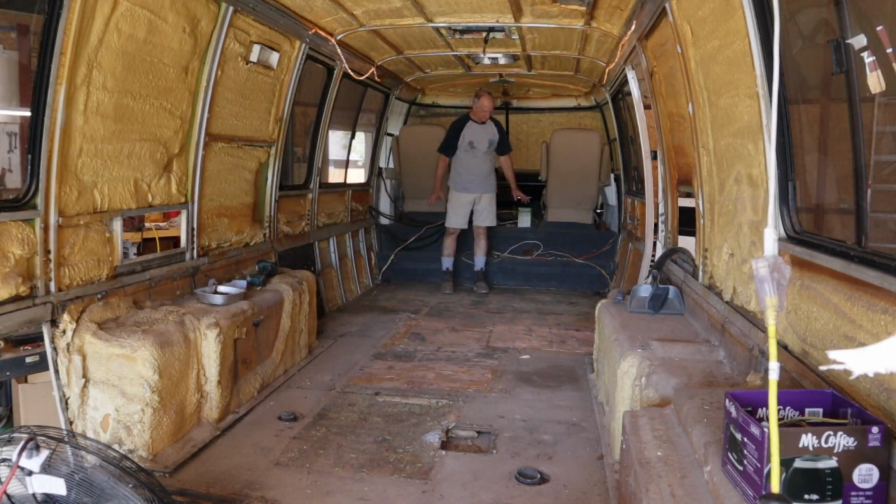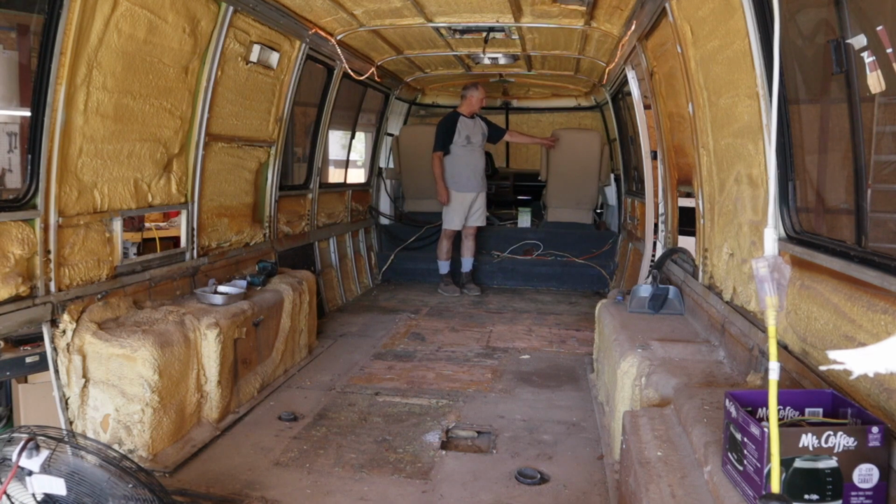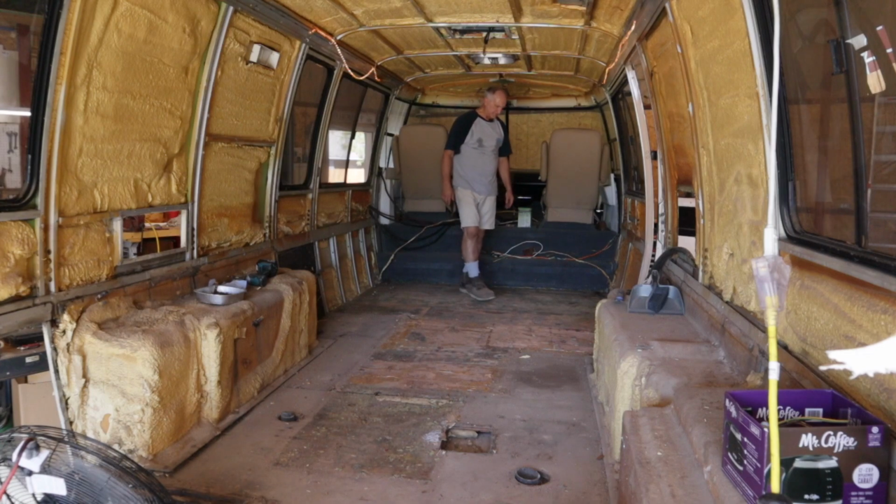This is all remnants of carpet padding here. That's rotten in that corner, so there were leaks in this window or in that window. Same here, leaks. It looks rotten, the cardboard or the plywood. And the piece I pulled up, the leaks continued because those were starting to rot too, even though they were retrofitted later.